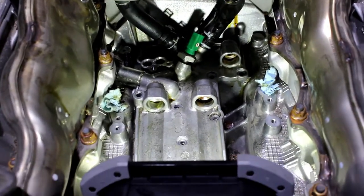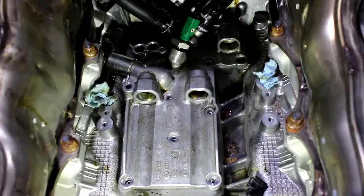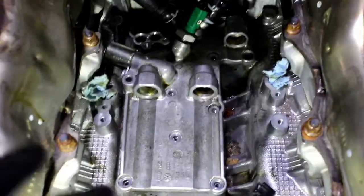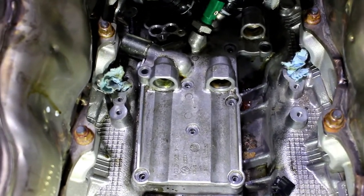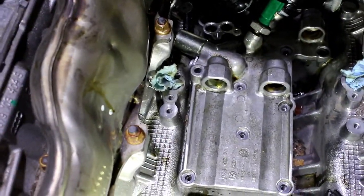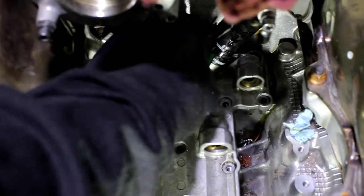I've already pulled it out and looked at my oil filter screen, which surprisingly had a little more in it than I thought it probably would for this many miles. The sending unit — I had to give up and take it out. It's a 24mm socket — that 24mm that sits in your toolbox where you think 'when am I ever going to use that?' Well, you're going to use it today.